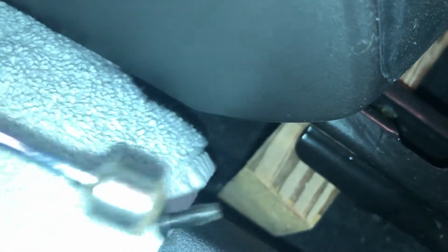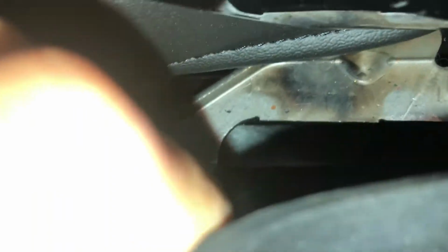So there it is. And the instructions say, once you do that, you can... So if I look in here, so I'm pulling this out, you can see there's a metal clip right there that has this engaged. And it actually doesn't look like your standard clip. It looks like I'm going to pull up on this. Oh, which I did, see? You pull up. This little housing just slides down over that piece. Pull up, and looky, looky. There's the Torx we need to get to on this side to remove this seatbelt attachment point.